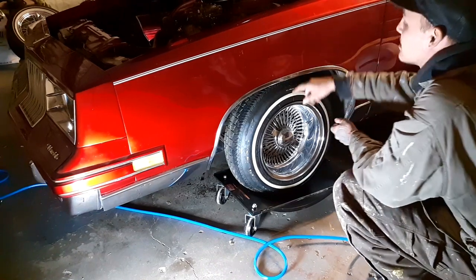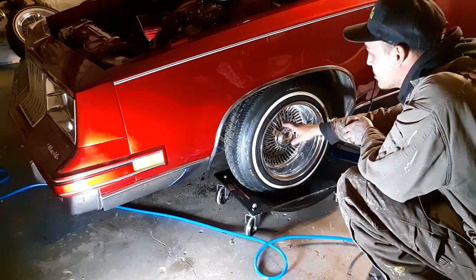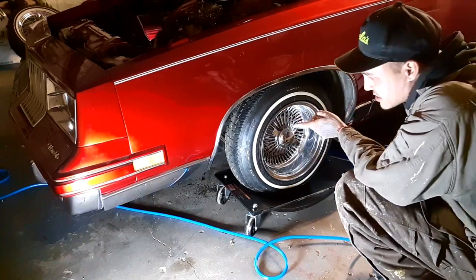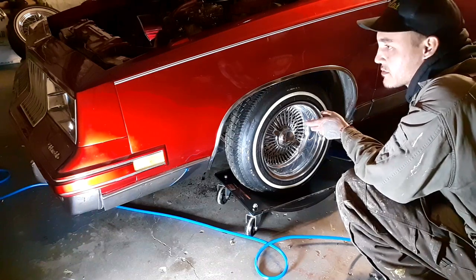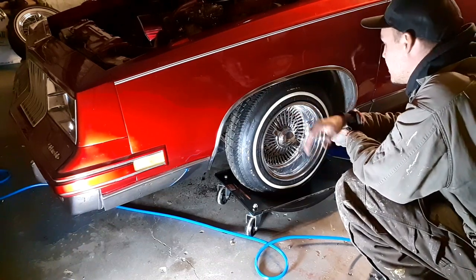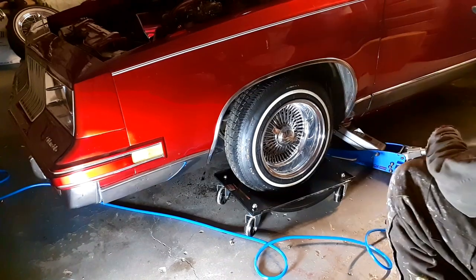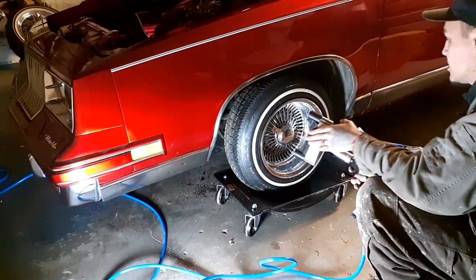What we're gonna do right now is take off the cylinder and leave the coil in the front, and then take off the sway bar — because that was still there and that stops the vehicle from going side to side and hitting three wheel like he wants to. So we're gonna take that off and try to take off this wheel with the tool we got.